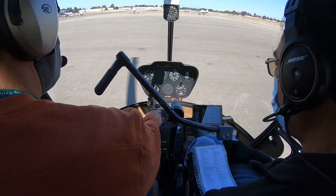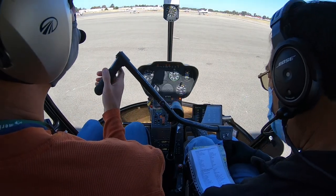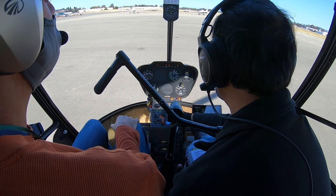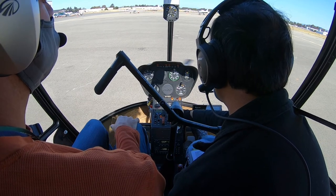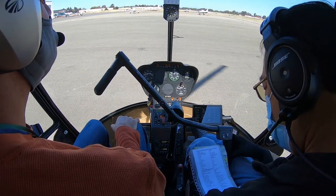Okay. I've got green on both sides. Okay, on the green. All right, so let's do the mag check here. 1,000, 2,000, good. 1,000, 2,000, good. Back to both. All right. Carb heat check.